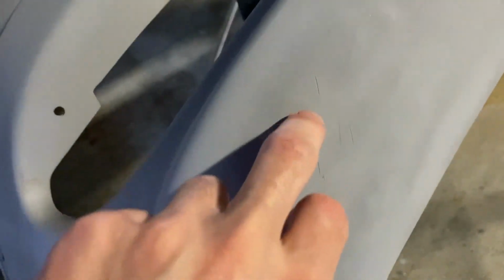All right, so here is a primed bumper, and there are a few spots like here. It's smoother than the edges, and I can see here there is a small crack on the edge where the primer has dried. I will try and smooth that out with the sandpaper, and hopefully that will be it. And there's another crack here, probably from the temperature change. There are also deep scratches here.